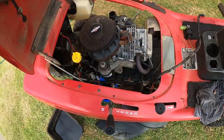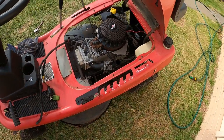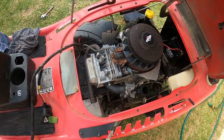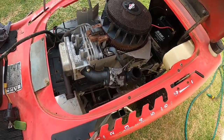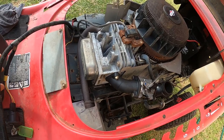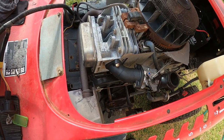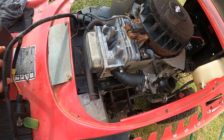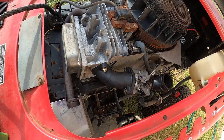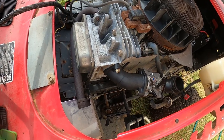And I'll be making a lot more videos. I've just finished the boat engines. I'm planning on getting more boat engines and stuff like that, boats, ride-ons, motors and stuff. And if you have any questions about it, I did have the valve settings. I think I told you, I set the intake at 4.5, so 0.45 on the feeler gauge set, and I set the exhaust at 6, I think it was. It was 6 on the exhaust and 4.5 on the intake.